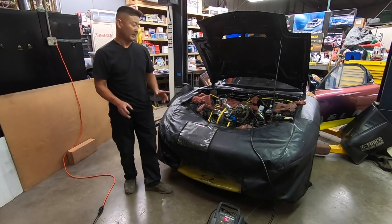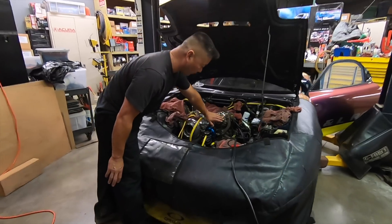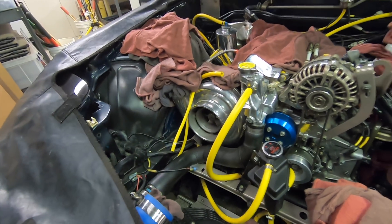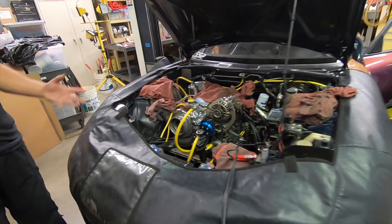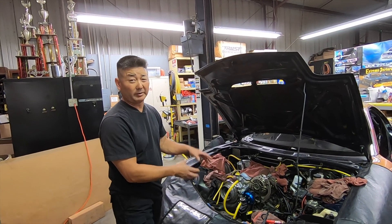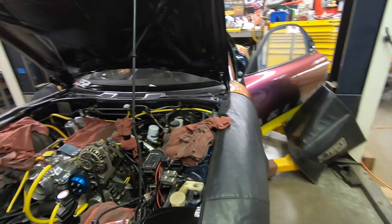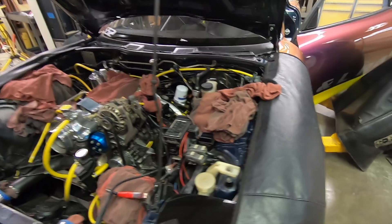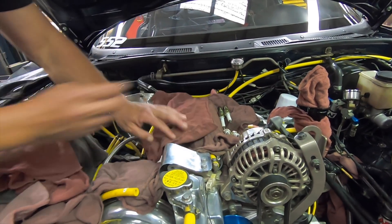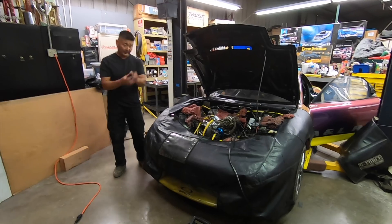As we work towards charging the oil system, some things to point out especially for you guys doing it for the first time: take a visual and make sure everything is clear of anything that is going to move, especially in the drive belt area. Just make sure nothing is going to get sucked in. Always check the inlet to your turbos — there have been a lot of people, friends I know, in the mad rush who forget and things go really bad. Also recall that we put lubricant into the combustion chambers; that's all going to come out with the spark plugs out. Do yourself a favor — whether rotary or piston — lay out lots of loose rags so there's something to catch it. Don't stuff the rags into the intake manifold or anything that is open; just leave them loose so they won't get sucked in.